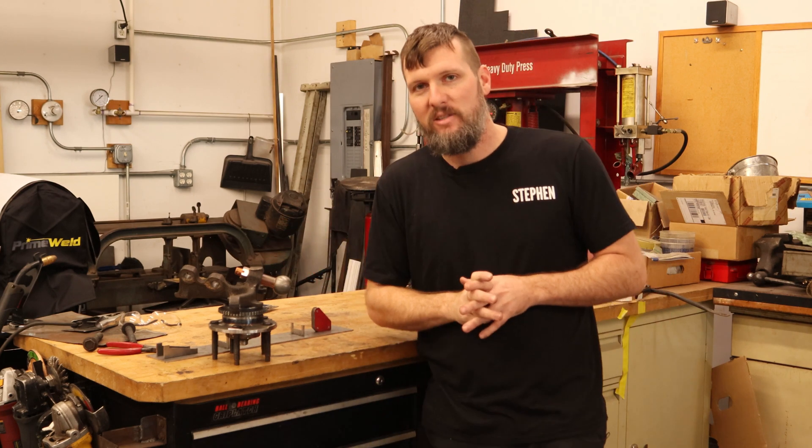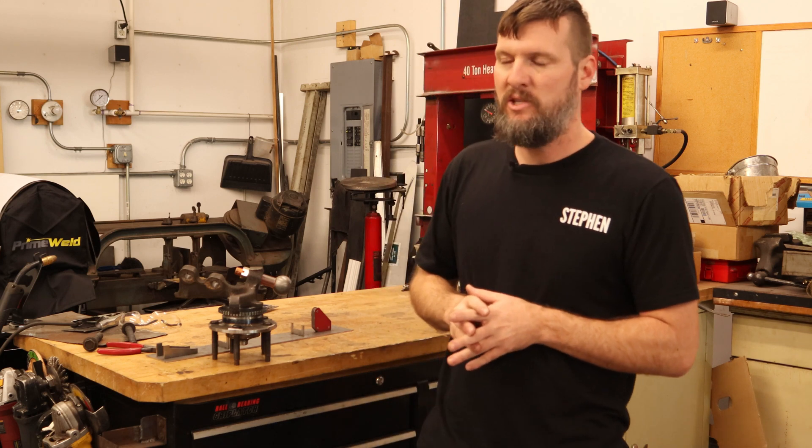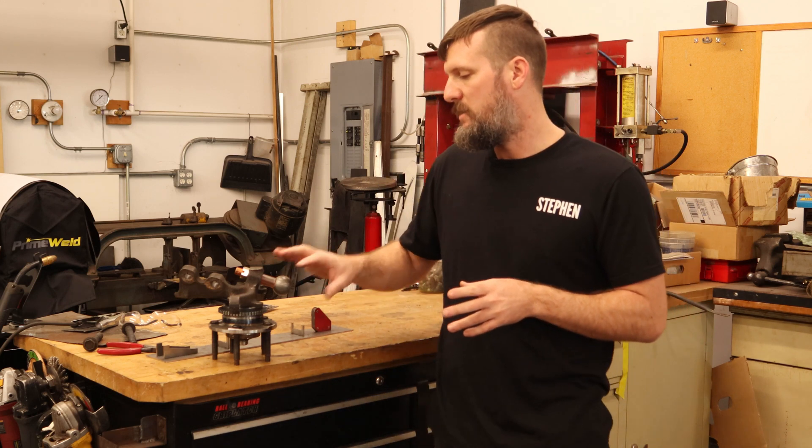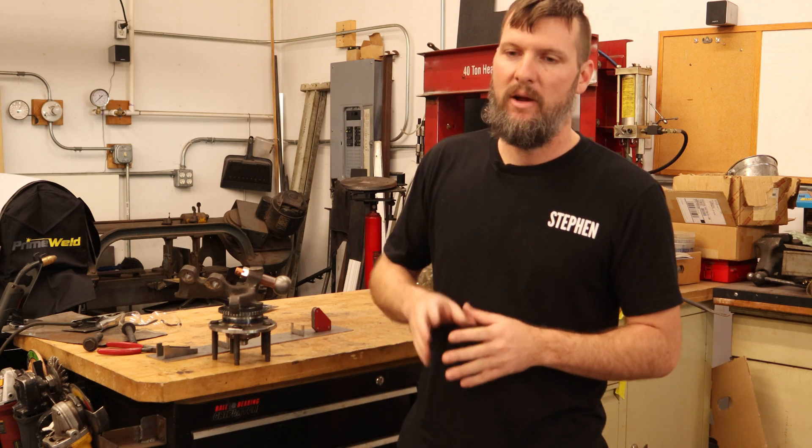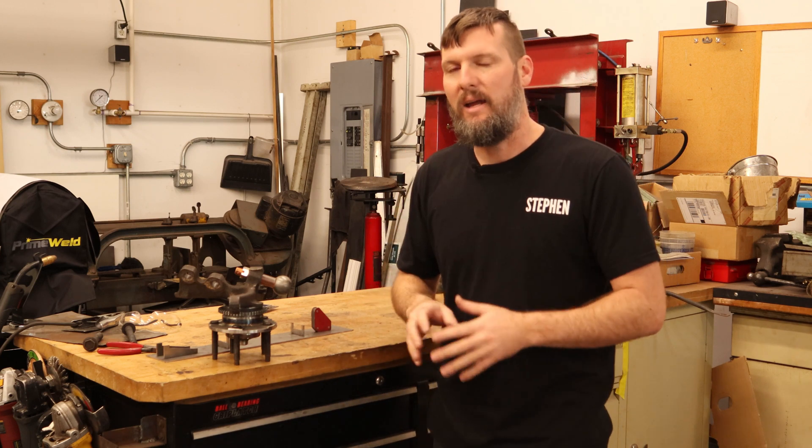But those three measurements are crucial for the suspension geometry. Once I fixed them in the model, it showed that I had positive camber just sitting at ride height, and it got worse from there.